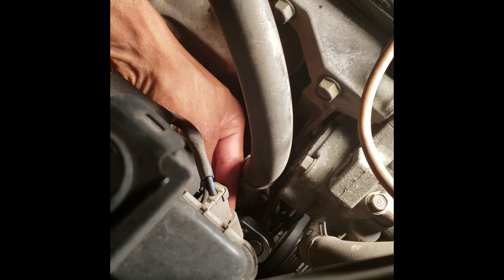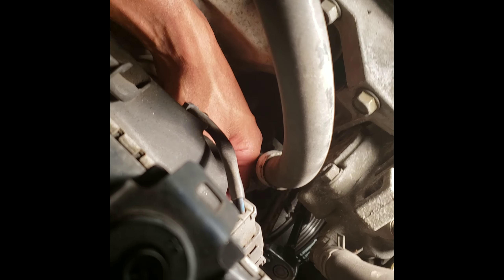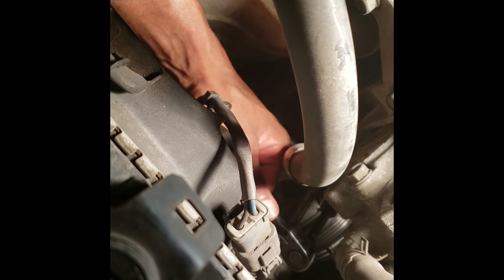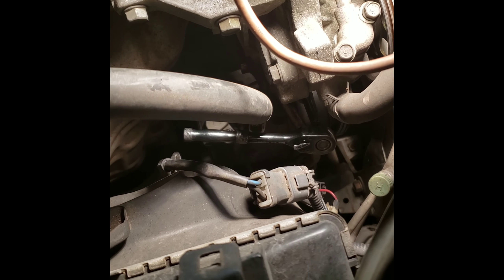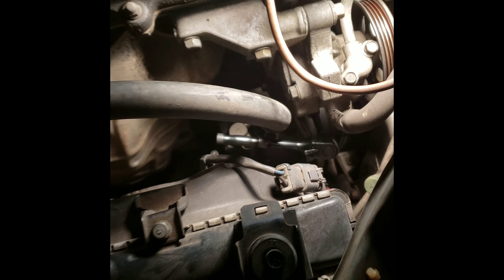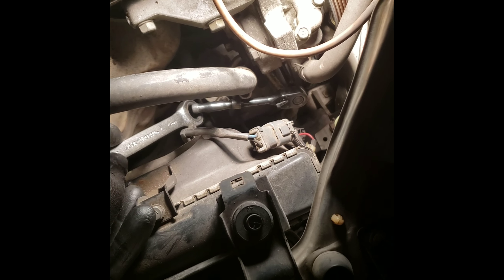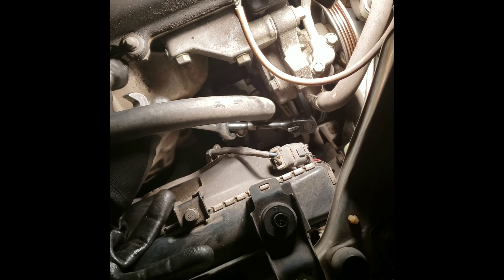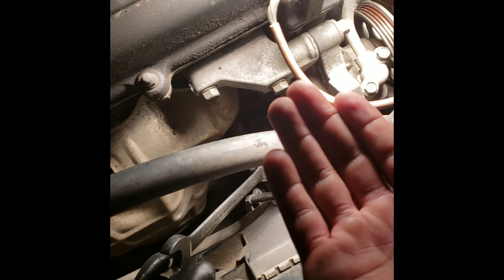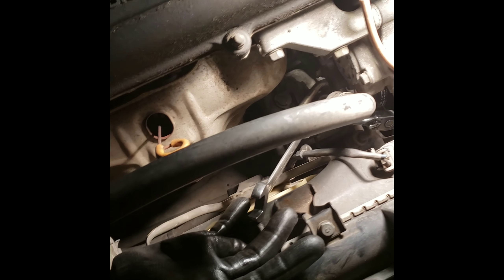Right here — you are going to slide it over and get it to sit on that nut. And then the fun part is to crack it loose, which you would need two hands for. You are probably wondering how do you turn that little bitty ratchet down in that tight area — with a wrench of course. You just slide the wrench over the handle of the ratchet and then you have more leverage. But be sure to use your other hand and place it under the small wrench when you push down, so that you don't break the bolt off.